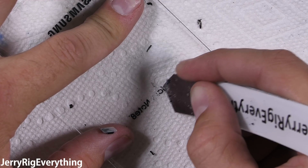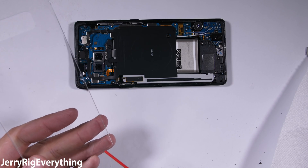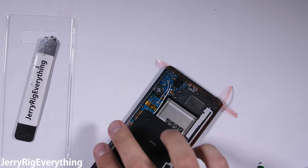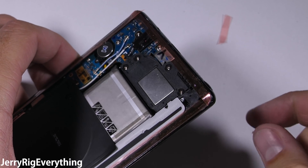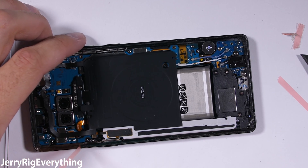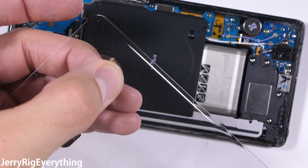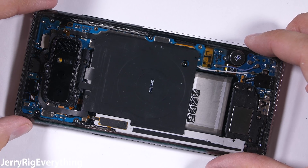I'm going to de-brand my phone at this point by removing the logos from the underside of the glass — they just scrape off. I'll get my clear double-sided tape around every edge of the phone. It's worth mentioning that any time you open up a water-resistant phone it will 100% not be water-resistant anymore when you put it back together. The tape all around the edge should keep dust out, but I wouldn't trust it around water. My back glass panel is clean at this point — a bit of glass cleaner got rid of all the fingerprints. Then the camera lens with the sliced fingerprint scanner ribbon gets put back into place, and the whole back panel can get set back on the phone.